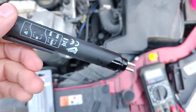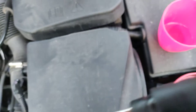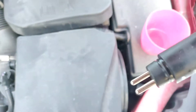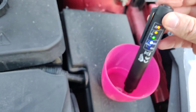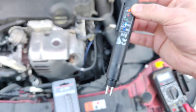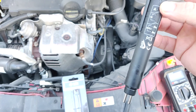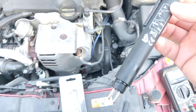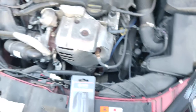Just to show what happens when there is a lot of moisture — I have a cup of water here. I went ahead and cleaned the probes off with some paper, turned it on again, and stuck it in the water. We can see that the LEDs light all the way up and it's in red. How this device works is it measures the electric conductivity of the fluid — water conducts electricity, which is why it gives a higher reading and lights up red.